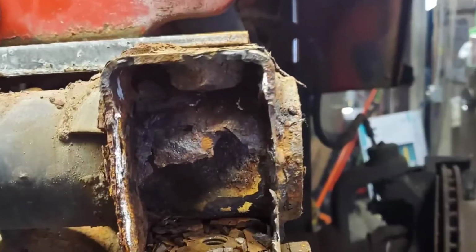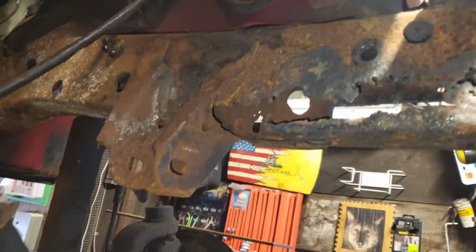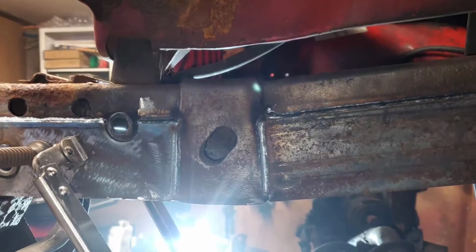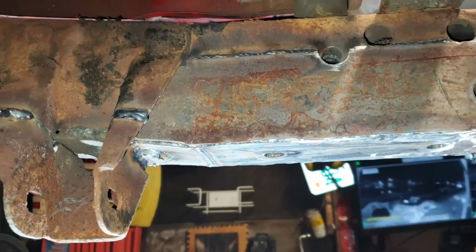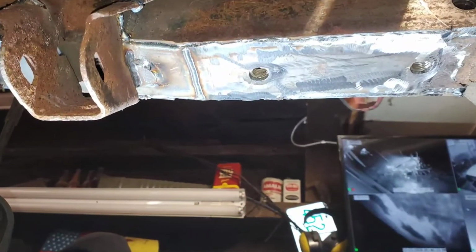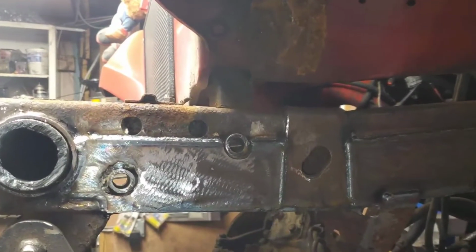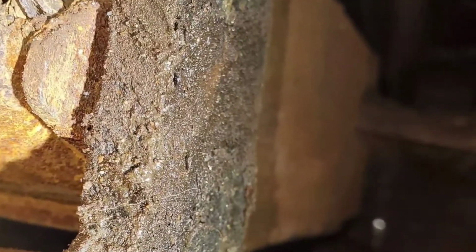And most of these spots you see are common to the YJs. I'm not sure if you know about YJs, but if you do, you know that these are common spots, and you can actually get weld-on caps, pieces of frame. I'll see if I can find the link to them and put that down in the description if I find it. But we ended up purchasing a rear one just because the amount of fabrication just wasn't going to be feasible fun-wise.